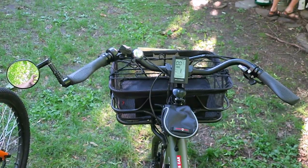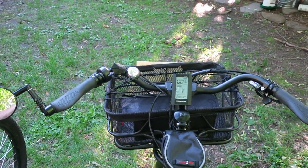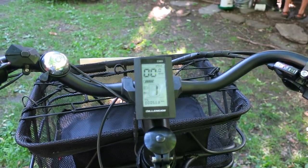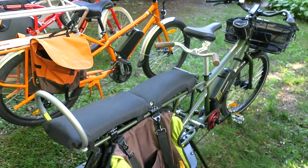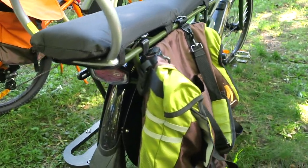You have to understand that when you have a mid-drive, you have to sacrifice the triple crankset — you can't have three gears up front. The Radwagon is actually 21 speeds, but frankly you don't need it — you really don't need it. We also upgraded the chain wheels on these bikes because the Bafang mid-drive is really nice but the chain wheel is not so great, though there are all kinds of upgrades you can do. This can handle all the different Yuba accessories — we have it set up with bars on the end, the soft spot, the ring on the back.